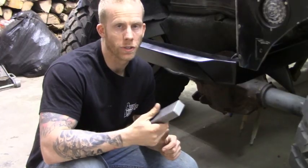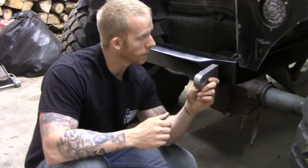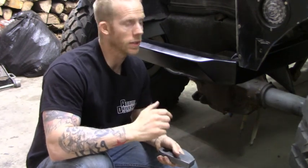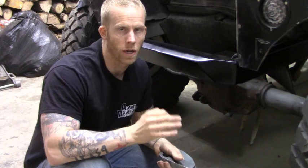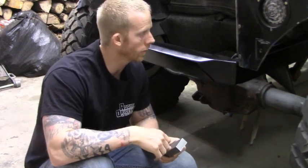The installation of these should be pretty simple. I'm going to figure out where I want to mark them on the bumper, cut it out, stick it through the slot, and then weld it on the inside and weld it on the outside. I'm also going to tie these into the frame just to make sure they're extra strong, just in case, as far as pulling and stuff like that.